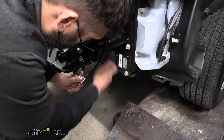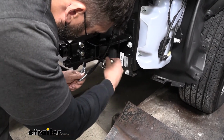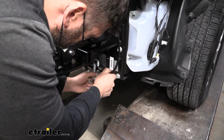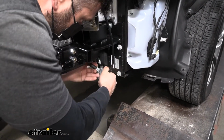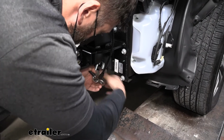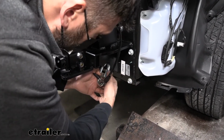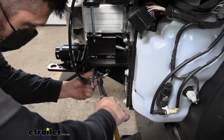And then they're both going to come out sort of at the bottom here. There should be a hole there on your base plate that we're going to attach one of the quick links to. Just like so. And we'll place one end of the cable through the link, the other end through the other side there, just like that. And now we'll just simply tighten this nut here. I'll tighten it by hand, then I'll come back with a wrench and turn it another quarter turn or so.